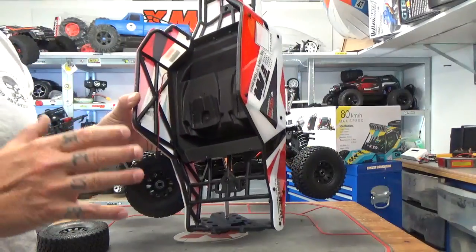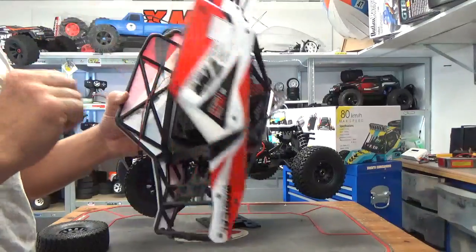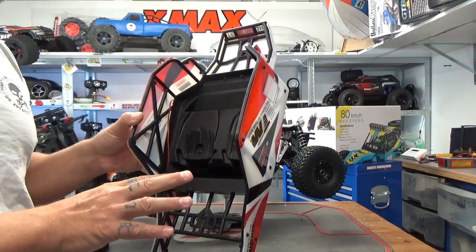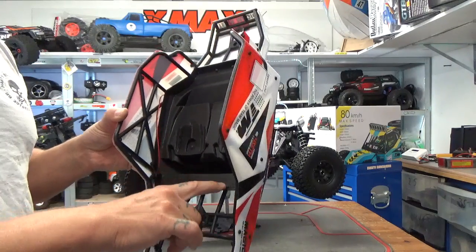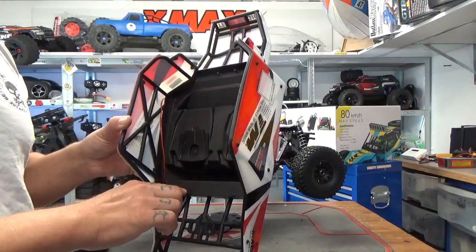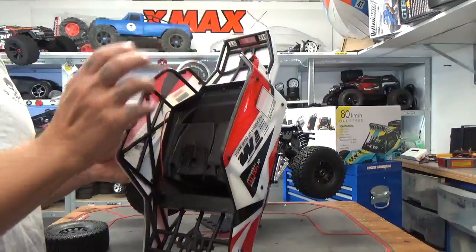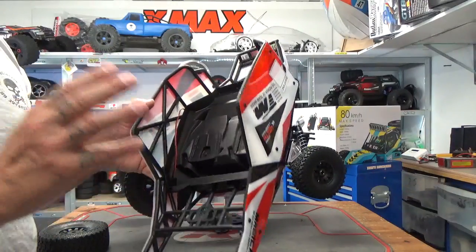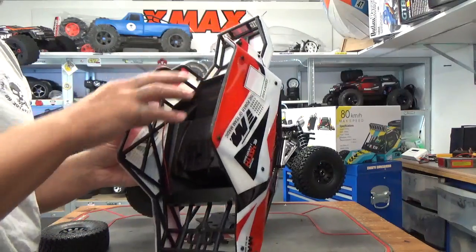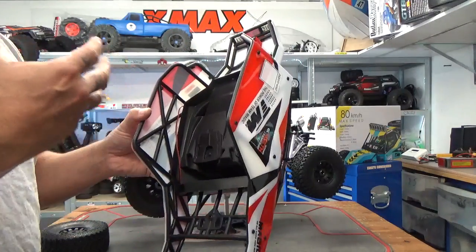What you have to take care about, this is something you have on all cars that have a body panel in the body with some drivers, especially on a cage, is that the cage will move on impact and you will destroy the inner parts here, because this is Lexan, this is screwed on, and if you have too much deformation of the cage, you will rip this off. So I can only tell you the best way to mount this is with Velcro straps.